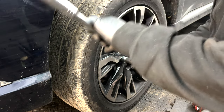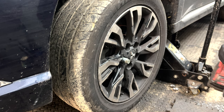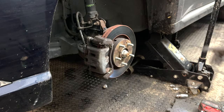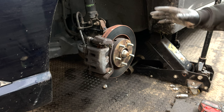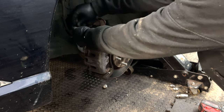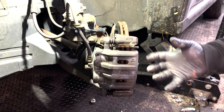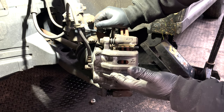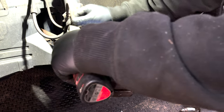So this customer was also complaining about a vibration. He got the car tracked and everything balanced but it didn't solve the problem. He said he'd come back and balance the rear as well. But you can clearly see here this was getting pretty hot. As you can see I've got new grease and new hardware, and I put the pads in when I realized the pistons wouldn't go in - one piston wouldn't go in. The customer needed the car; I told him not to drive but he needed it, so I just put the old pads back in. We're going to have to replace the caliper here.